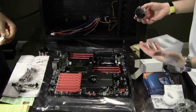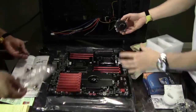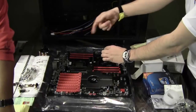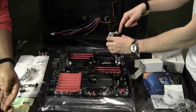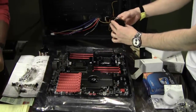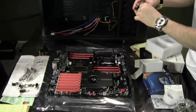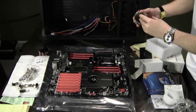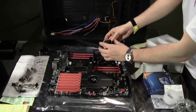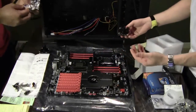In relation to the whole build, we're putting everything on the motherboard before we put them in a case. So when we have our water blocks on here, we're able to accurately measure the amount of tubing that needs to go from one to the other — we're going to be hooking these up, just make sure that the in goes to an out and you'll be good. You'll keep the flow. Also make sure you don't have too much of an angle so the tube's not popping out, because you may conflict with the side fan on the case. Just different tips before you put these things together.